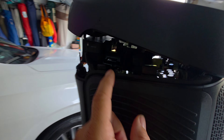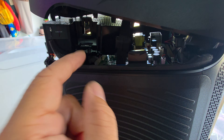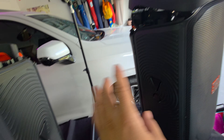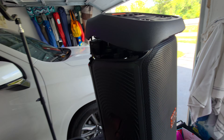That brings us to the rest of the board - the power board and the motherboard, which is the main board. That's what we're going to look at next, because now we feel that's where the problem is. I can always swap one of those two boards to see if I continue to have the problem. But this problem is board related, so let's continue to troubleshoot. I'm going to swap them back.